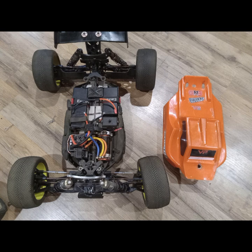Got hot body steering knuckles because I broke one of the ends off one time of the original ones, and they're pretty small, so I wanted to upgrade them to something larger. I've got little spacers in there for the 2S shorties. I converted it to run shorties instead of the full size 2Ss.